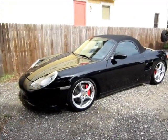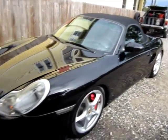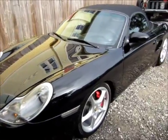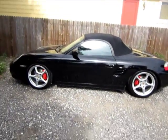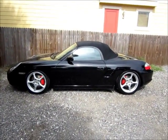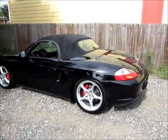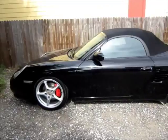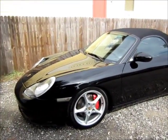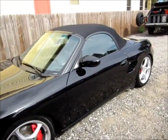It's quite overcast right now, as it generally is at the end of the day. I did a two-step correction on this Porsche. I used M105 by Meguiar's, and then I used the SMR, the Star Products Professional Line Swirl Mark Remover, that I hadn't used before, and it worked phenomenally. I love that polish. The paint then was isopropyl alcohol wiped down and received an application of the Opti-Guard permanent paint coating.